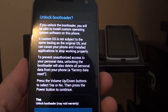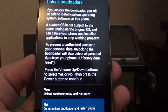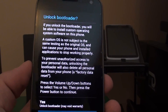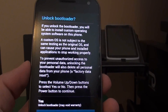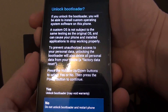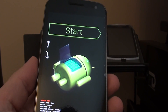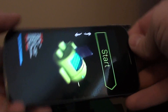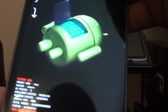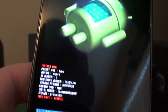Now it's going to ask if you want to unlock the bootloader. Be warned — this does void your warranty as it says right there, and it will also wipe all data on the phone, so anything you have on there up until this point will be wiped out. I haven't set mine up because I knew this was happening. You have to use the volume key and the power button, and there we go — we are unlocked. If you look, it says lock state: unlocked. Sorry, it's been a while since I've done a video.